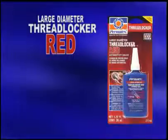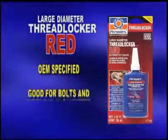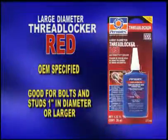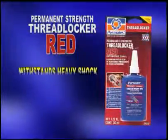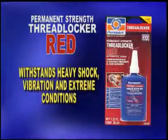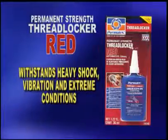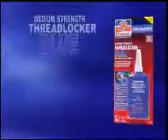Permatex Large Diameter Thread Locker Red is OEM specified as a high-strength adhesive for locking and bonding large bolts and studs 1 inch or larger in diameter. Permatex Permanent Strength Thread Locker Red is a permanent high-strength product that's applied to fasteners 3/8 inch to 1 inch before assembly. It's designed for securing parts that must withstand heavy shock, vibration, or extreme chemical or environmental conditions.